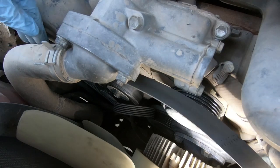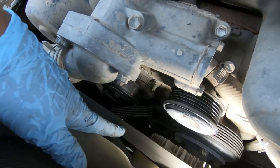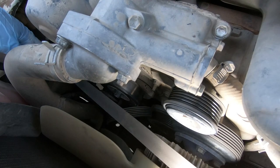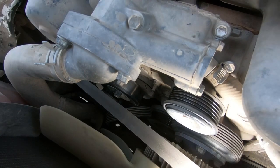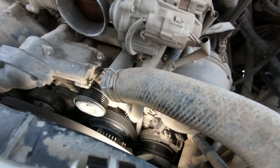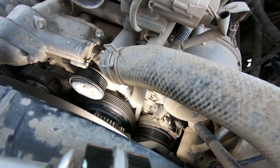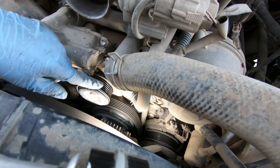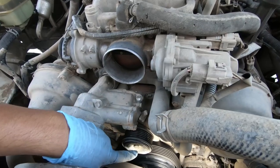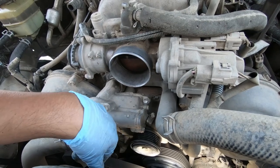Then you can pretty much move the belt out of the way. You don't really need to because the idler pulley is right here, but if you want to test your pulleys and see if any of them are messed up and making funny noises — this one is actually making a lot of noise. It's not super noisy, but it's also not good. So to get this guy off, it's just a regular 14mm — no reverse threads on this one. It's just lefty-loosey and it'll come out.